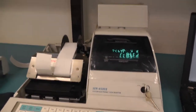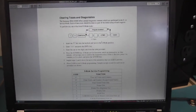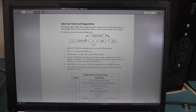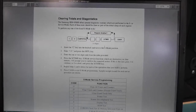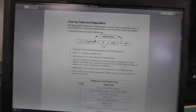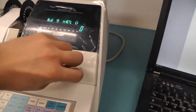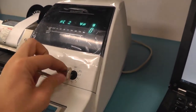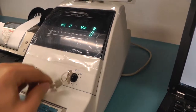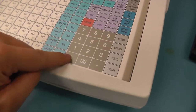The printer really seems to be broken, because I found the programming manual and the operator manual. They're quite easy to find on the internet, and there are actually some diagnostic tools, so it tells to insert the key, go into the S mode with the C key. S stands for service mode, and the C key is the most powerful, which allows you to go in service mode. Then press 1-0,